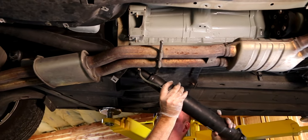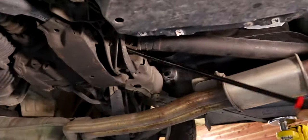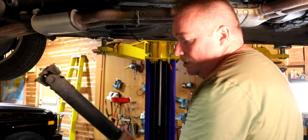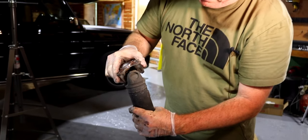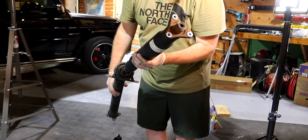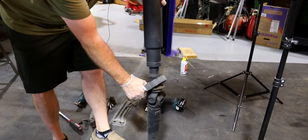We were still a little stuck in that back end — nobody knows why — but it's not stuck anymore. So here we are. See that U-joint's toast — you can barely move it. A lot of times you get rusty dust around them. The center one's good, it's got some play in it, a little rusty on the end. And then our main culprit — that's a no-go. It's actually totally ripped out, you can see there.